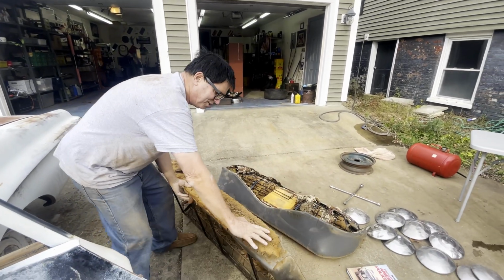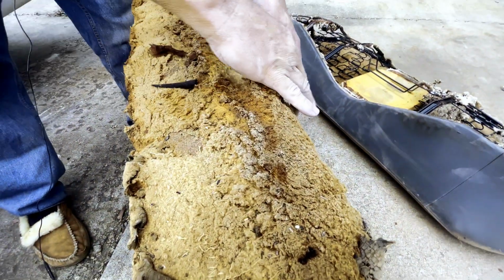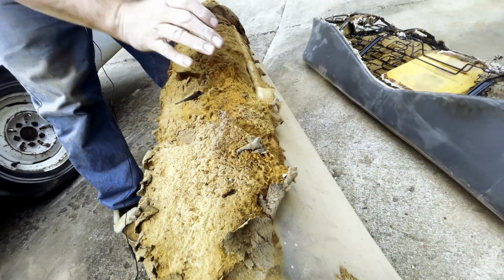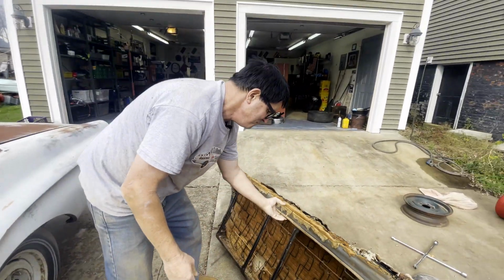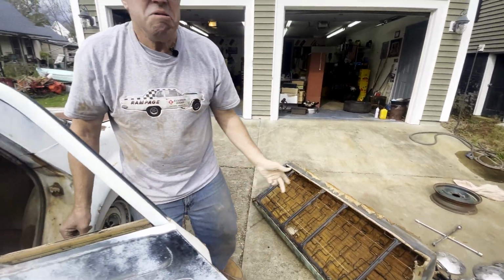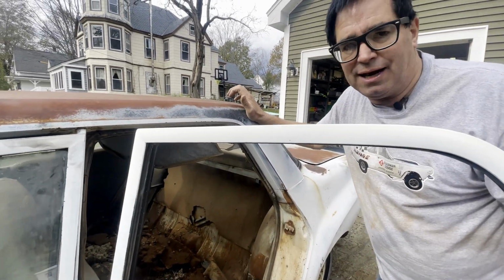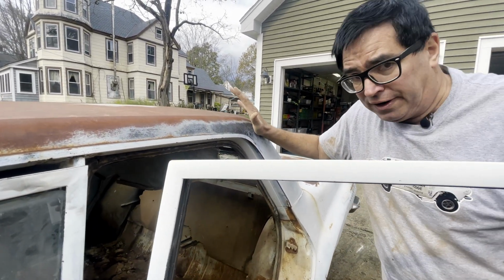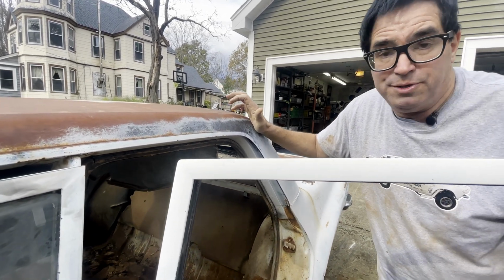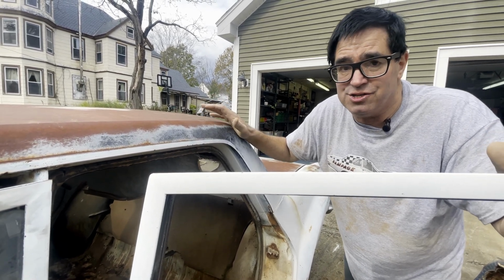The seat has the usual Texas burnout on the top. Look at this. But again, there's that generic upholstery, which may well have been the original. No pattern, get the job done, police stuff. I don't think this is reupholstered, so that's probably the original pattern. Will I keep that? Yeah. In fact, if I can clean these seats up and use them again, I will. But more than likely, the vinyl is gassed off and become brittle. First person to sit on that would probably crackle it. So I'll reupholster them if I need to. The beauty is, being no pattern, it'll be simple to reupholster them. There's no need to find vintage upholstery.